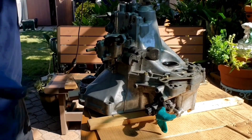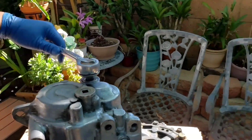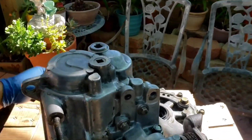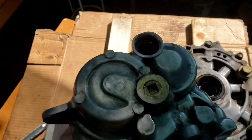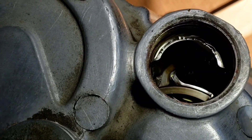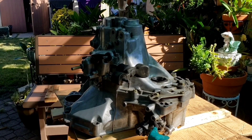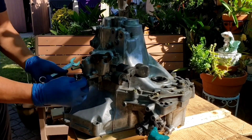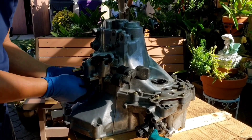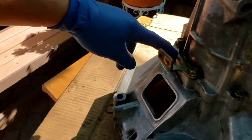These two caps need to be removed. What's housed in there is the retention spring — it's what puts tension on the forks. There's a little ball in there that rides on the forks, on the shaft. Just break all the nuts and bolts and then I'll be cruising along. The bracket — make sure the bracket for grounding the wires is put back in the right location. I think it can only go one way.